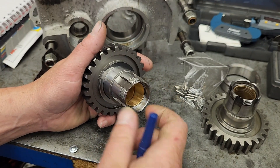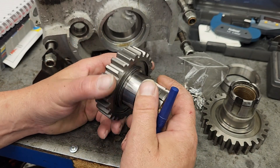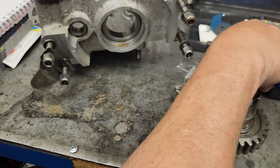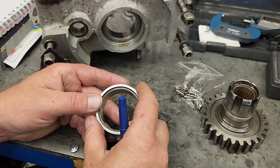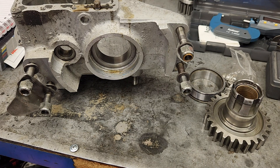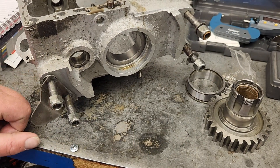That crooked seating would pull the bushing against the main shaft, cause early failure, lead to an oil leak, and mean I'd have to go back into this transmission — which I have no intention of doing. So for my particular engine, I'm going to put in a new Jim's bearing race, because this one is suspect and has to go. My next video I'll be sweating this one out and pressing in the new one, getting my cases cleaned, and hopefully building this motor. Don't forget to subscribe — thanks for watching.